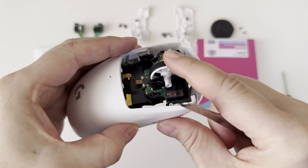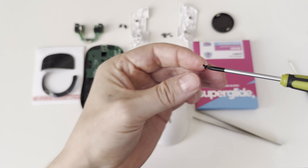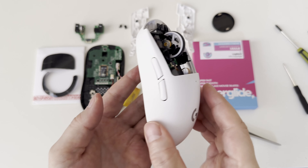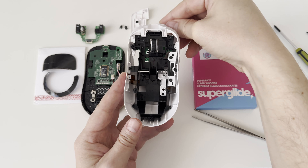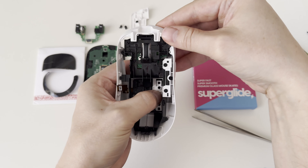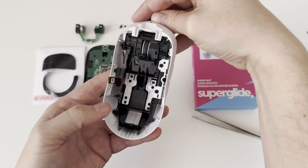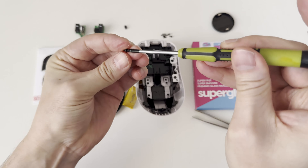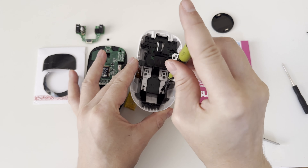Now I can tighten up the switches board with all 4 screws using the small Phillips screwdriver. Make sure you tighten them properly to avoid an unnecessary increase in bounce time. Let's flip the top cover over and install both left and right buttons back onto the shell cover. There are rails and holes for screws which help you install the buttons properly — you should hear a small click sound when each button is seated well. This is very important, otherwise your buttons will be misaligned with the switches or will wobble more than is within tolerance. I could hear both clicks of the left and right buttons when seated into the rails, which is a good sign. Let's screw in another 4 small screws, as tightening these properly is also important to avoid button wobbling or negative impact on bounce time.